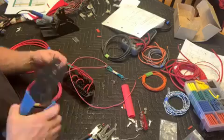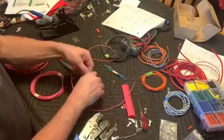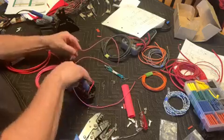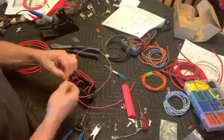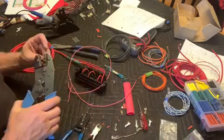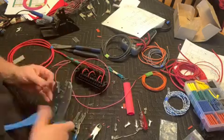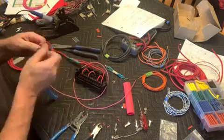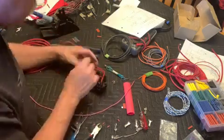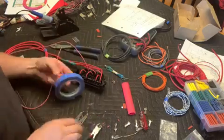So now we're starting pin 85 in our diagram on the relays, that side of the circuit, and that's what's going to bring power into each of these relays for the control side. With this power being ignition controlled, and on the fuel pump side being ECM controlled, and then we put a ground to the other side of the relay, pin 86, we then have a circuit that we can control that relay.